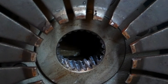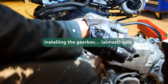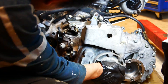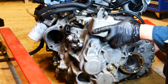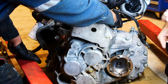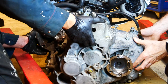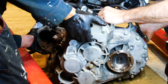Finally, add a coating of grease to the teeth of the clutch plate. Now it's time to get the gearbox on. I managed to get the gearbox lined up to the clutch by myself, which was great, but needed some help for the final wiggling of the gearbox to get the bolt holes to line up and started in their threads. A big tip here is that the gearbox should easily push onto and touch the block — if there's resistance or the bolt holes don't line up, you don't want to force it on. I always try to get two bolts mostly threaded on by hand before installing the rest and torquing them down.